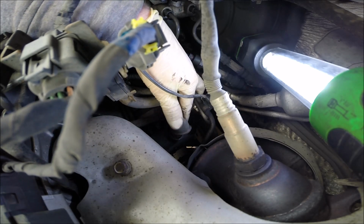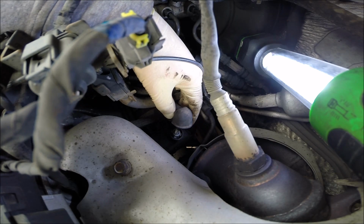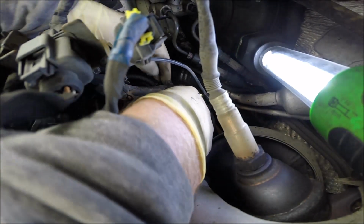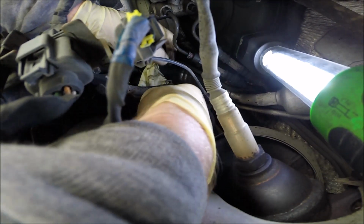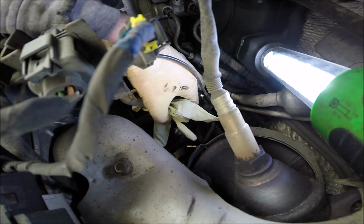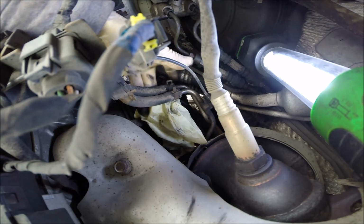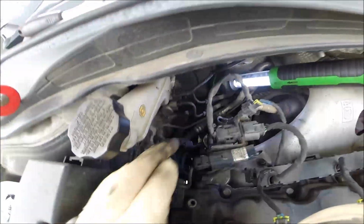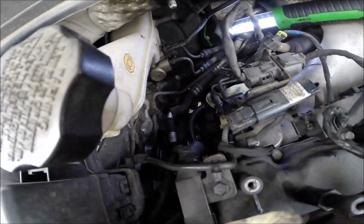Okay, so be careful what you do now. To isolate this very simply, use tape, but we can use any glove as well. Just put it over this. One second, I'll show you. Yeah, do something like that, so 100% the metal will not touch anything else. But I tell you, if you don't feel good with this, disconnect the battery. That will be easier. For better and safer access to release this piece, I disconnect the socket. Still keep the ignition off.